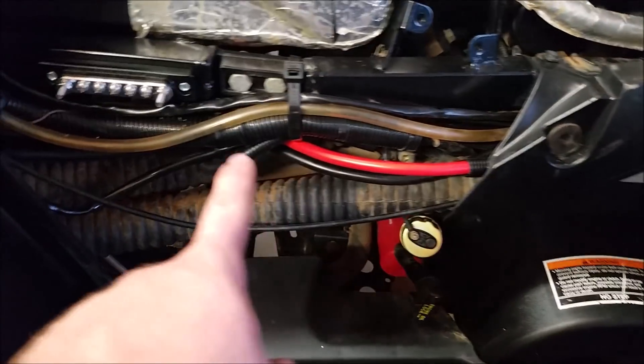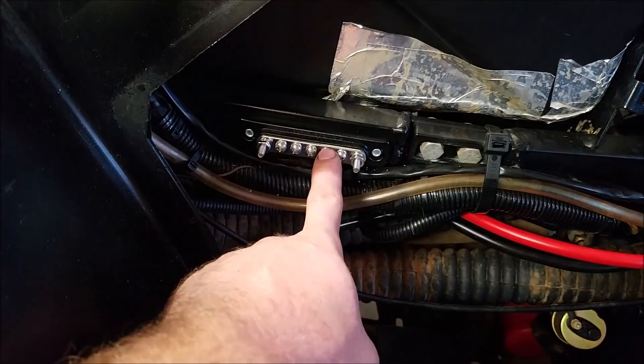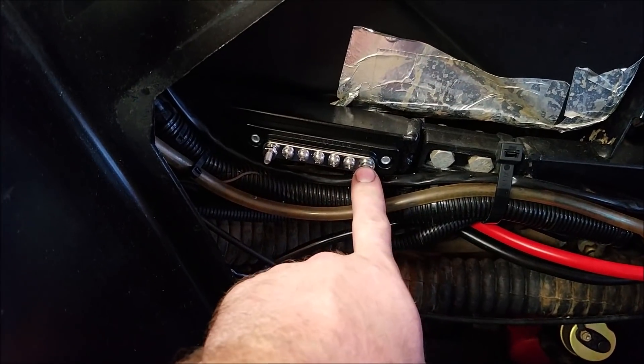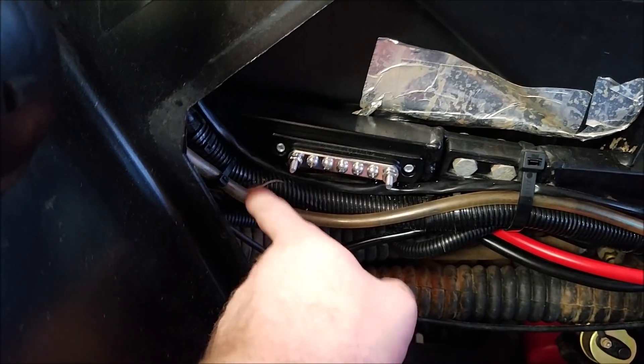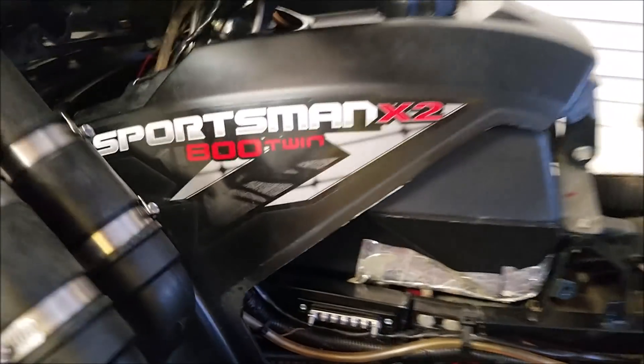The other thing I've got to finish up is taking the power wire right here. I did get a bus bar — that bus bar is going to be for my lights, of course running through here. Take one side of the winch, run it through here, the other side from here back to the battery. I'm going to use this as my battery terminal post, because where it's at it sucks, so that's going to be my new positive.